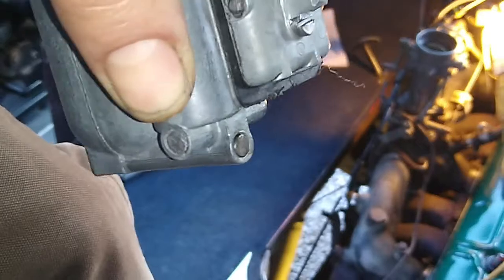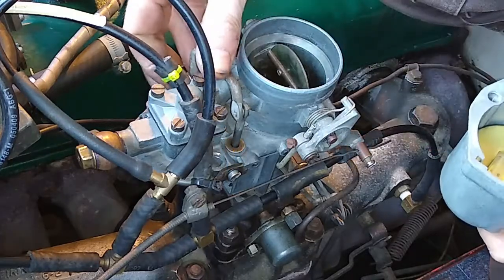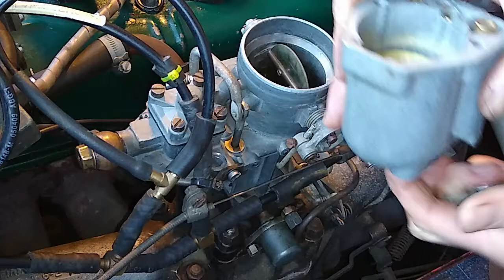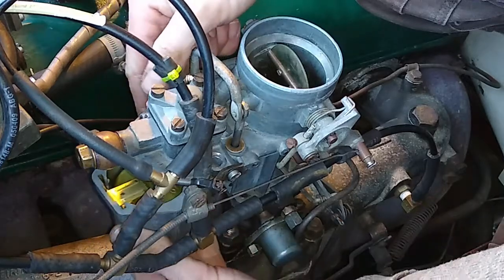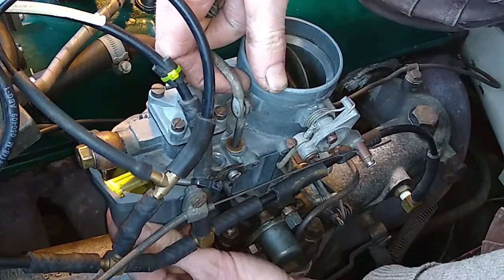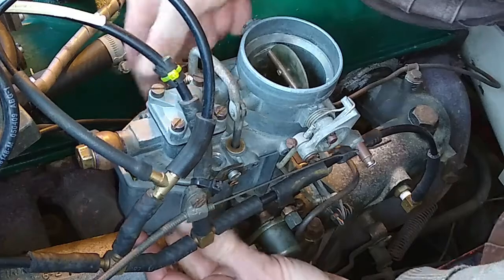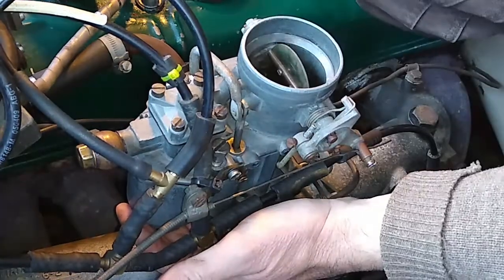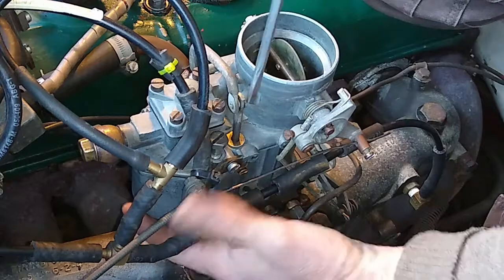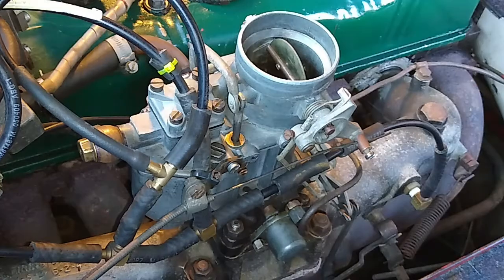Let's just plant it out a little bit and put some fuel on that to see if it comes right. So this is our Zenith carburetor - the float bowl is pretty easy to put back on. I can squeeze it in with all that plumbing for part of the LPG system, so don't panic about that. It just goes underneath here, lift up, get it to line up - there we go. Then we just drop the two bolts on top and do them up with a screwdriver. We'll start her up and see what happens - crank it a bit to get fuel into the float bowl because we're now on a mechanical fuel pump.